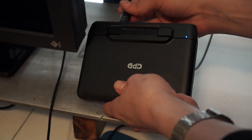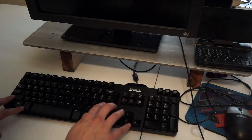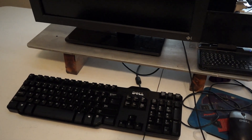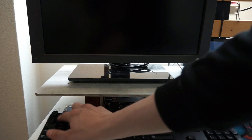USB-C works well enough with this system, so I ended up making a script for docking the computer. It was originally meant to be launched with a UDEV rule, but unfortunately it seems to hang with device removal. Also, if you press Alt+Shift+M and then press Escape, it should go back to normal. The script also handles HDMI and should be easy to change for all my other KVM devices.